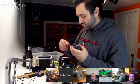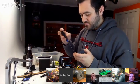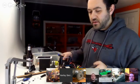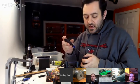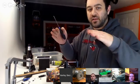On that Deadbolt, you move the upper links up. No, the lower links up. No, the upper links, right? On the Deadbolt, that chassis that you put on. Yep. Now, is that to help eliminate torque twist? No, that is to adjust the anti-squat value of the suspension. Okay, but that's not on throttle or on brake, that's just neutral, right? No, that will have the biggest effect during climbs. So on power, the force line of those upper links should now be pointing closer to over the top of the center of gravity. So now it should have an effect of trying to push the suspension down a little bit, rather than trying to drive underneath itself and lifting the rear end up.